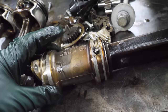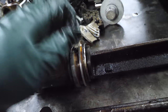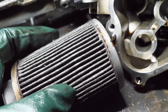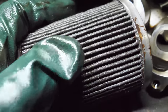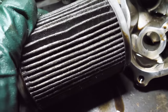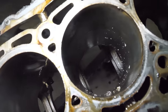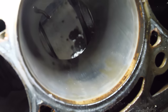Here are the balance shafts — this one definitely took a few hits, it was an innocent bystander. This one doesn't appear to have hit anything or gotten hit by anything, though there are chunks of metal stuck in the bearing. The oil filter — well, you guessed it, it's silver. I could scrap this for money — there's so much aluminum in here. It was definitely doing its job, but there's just so much metal it couldn't catch it all. The block bores — this is obviously the one that let go. There's lots of damage, vertical scratches, lots of wear. This one's going to the bin.